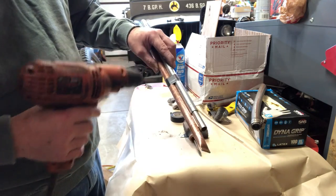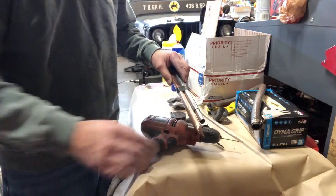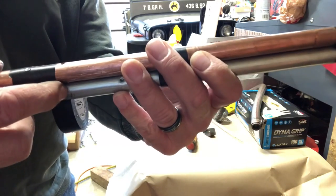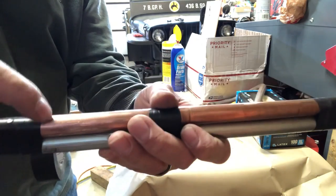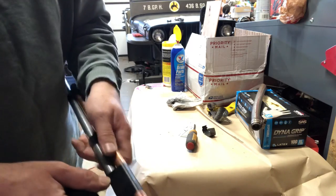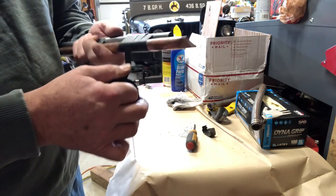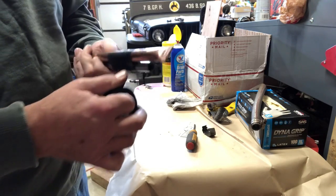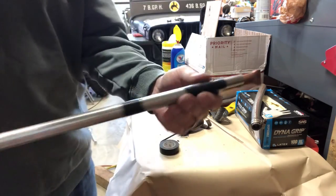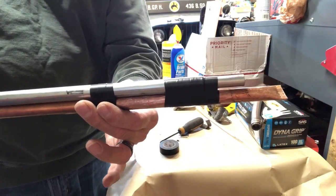I know a lot of guys are welding this area or putting some type of sealer in there, but until I order a tube that's designed to do the right thing, this is Watson's Field Mod. Let's get this thing in a vise. Drilled through into this pipe, not through the bottom. Now I'm just going to simply seal that hole up by wrapping it with electrical tape.